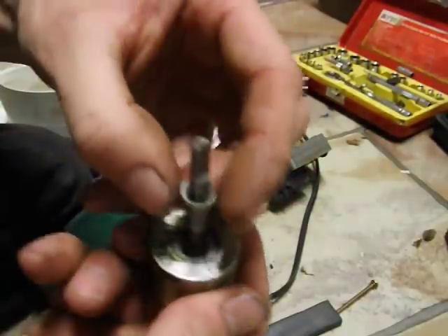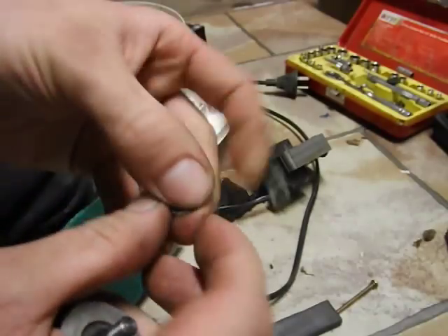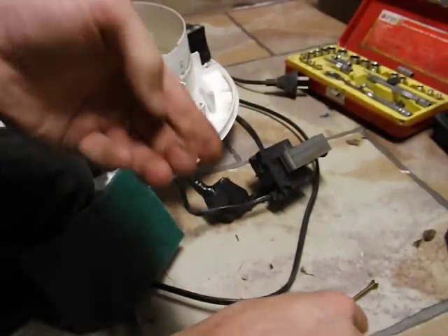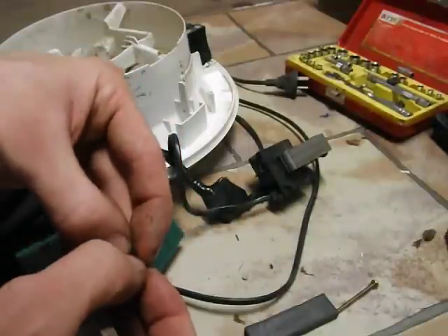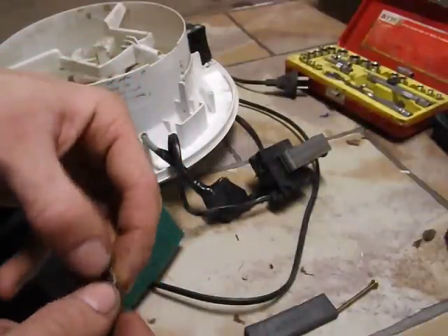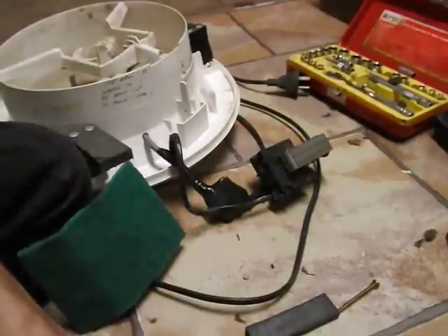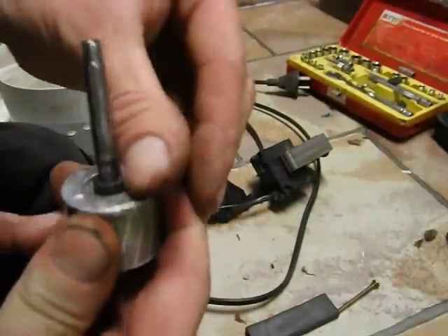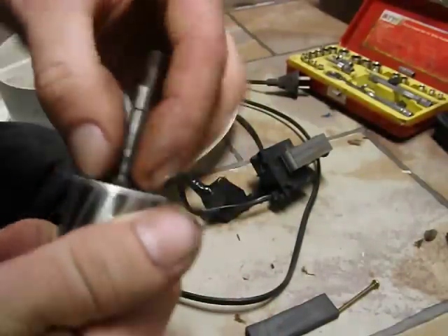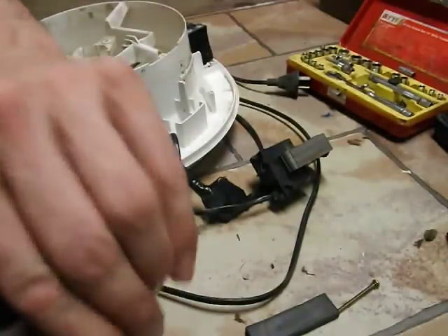What I recommend you do: very carefully take off the nylon shims to take up the end float. You should be cleaning everything. Don't mix them up. Don't break them. They're different at each end - it's been shimmed out to be correct. Make sure they're clean and keep them together - they're off that end of the motor. It's also got another black spacer there. Some of the bits are different, not all the same.